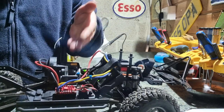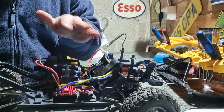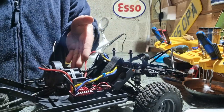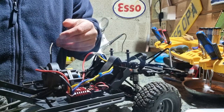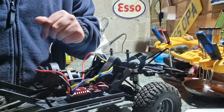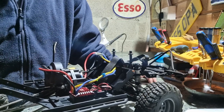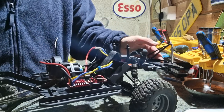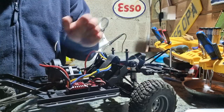Moving to the gearbox, it is a stealth gearbox that comes with it. There's a slight overdrive to the front but I can't remember the exact figure. I stripped it down and had a look inside just because I'd never seen one apart before. I re-greased it after wiping out a little bit of dirt, and put it back together. I did the same with the front and rear axles and diffs — just to look at the gears, which were perfectly fine. The last owner said he'd barely used it, so I just wanted to look and re-grease everything.